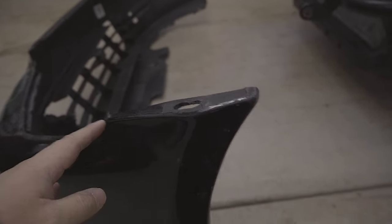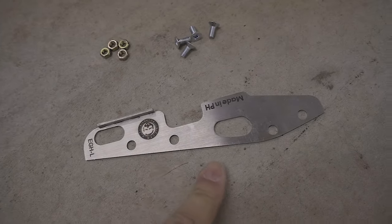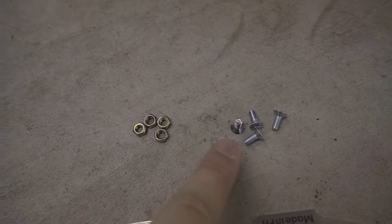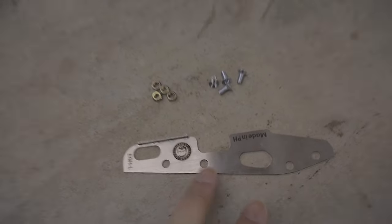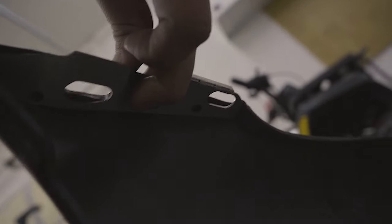The first official step is fastening this bracket onto the front bumper, and we're going to do that by drilling four holes. We need to line this bracket up on the bumper and use the paint marker. In that bag of fasteners you'll find a bunch of countersunk screws and a bunch of really small nuts — these are what you use to fasten and hold the bracket to the front bumper. Once you have it lined up, hold it there, go under the end, mark the holes, and then drill the holes.